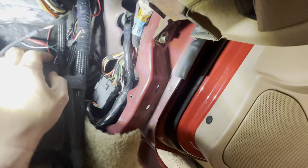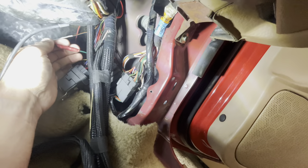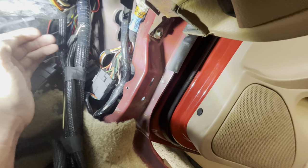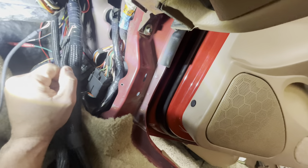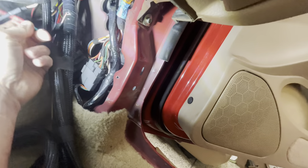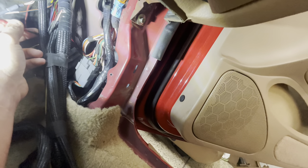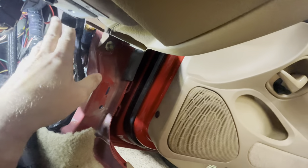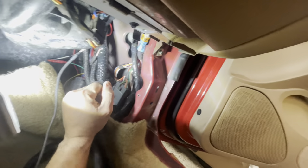I cut it right there and ran the wire directly to the trigger wire on the MF Customs harness, which I thought was fine. But that only sends power to the fuel pump. Up further in the harness is where it splits off to the injectors — that was the issue. So now I just need to grab this wire out of the loom and run a little jumper wire, splice our other green wire in together so that this wire plus the other green wire are joined. Since it's already connected up there to the split, it should all work. At least that's what I think, so I'm going to get it all together and then verify if we have power up at the injector.